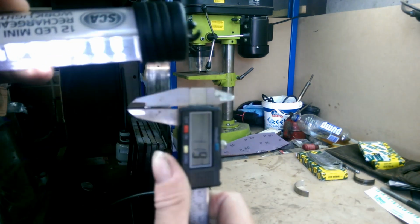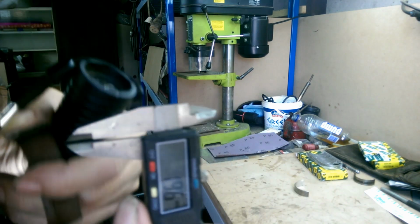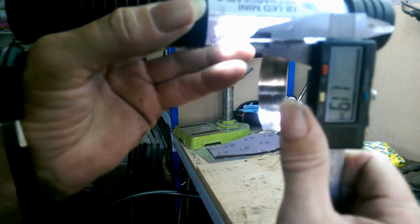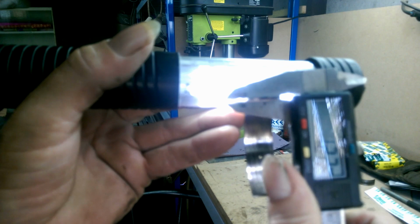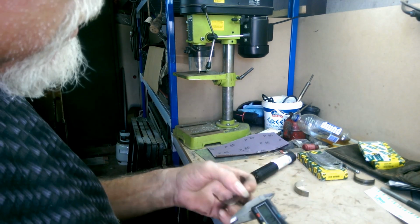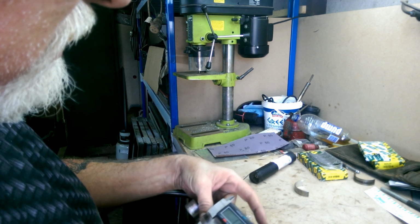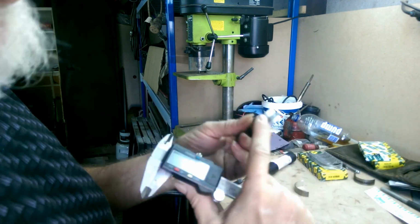Put it that way, let's put the light behind it. That side looks okay. That's the crank side. Rod journal side, again, there we go. I don't know whether that's picking up on camera, but that's nowhere near flat. But what we say, that was 1.13, let's zero that. That's 1.11, there we go. 1.2, 1.4, so it's all bouncing around because it's not an even surface.